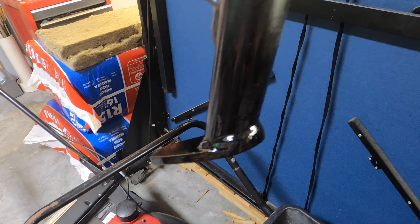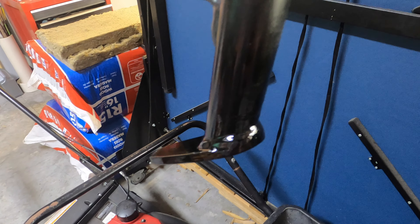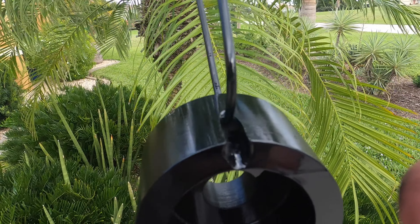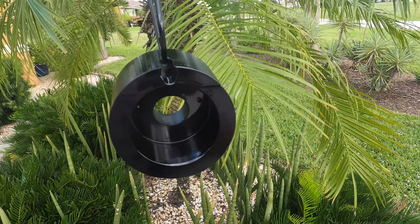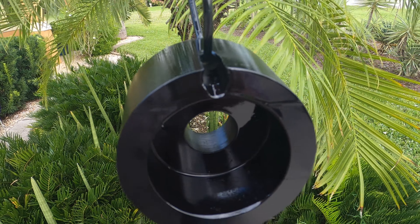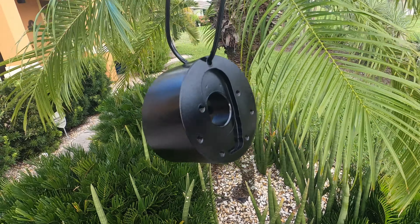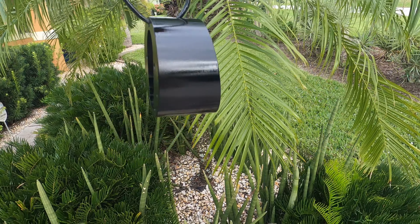This is the spacer and I've now spray painted it black. At the top part, right up here where that groove is, I had to drill that out and counter-bore it so that I could put the retaining screw for the mount on top in backwards because of the angle of the side stand. It's starting to look pretty good and once everything dries, I'll be able to fit it onto the bike and see how it works.